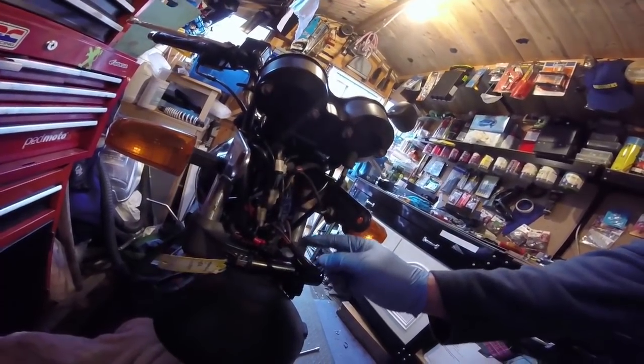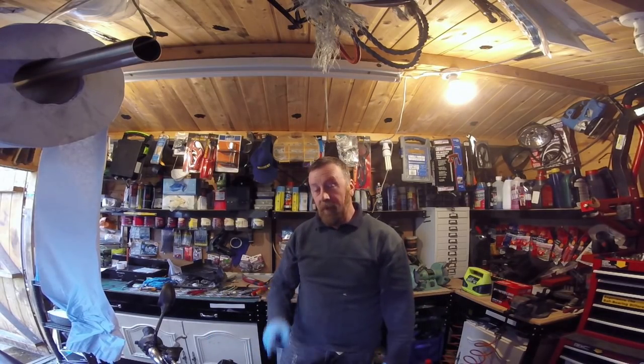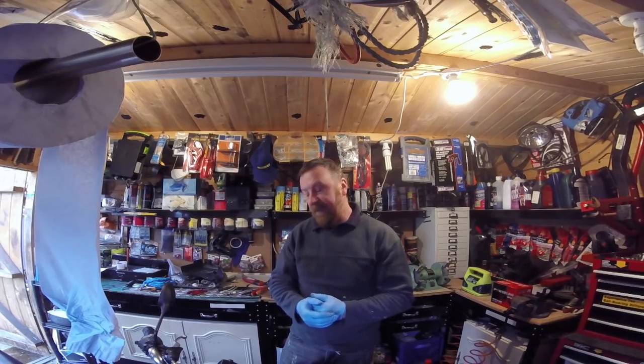So I took it apart and reconnected the old ignition switch. And I get spark. Although it's not starting yet, so clean the carb and so on. But all good so far then. I have spark now, which means the stator's picking up.